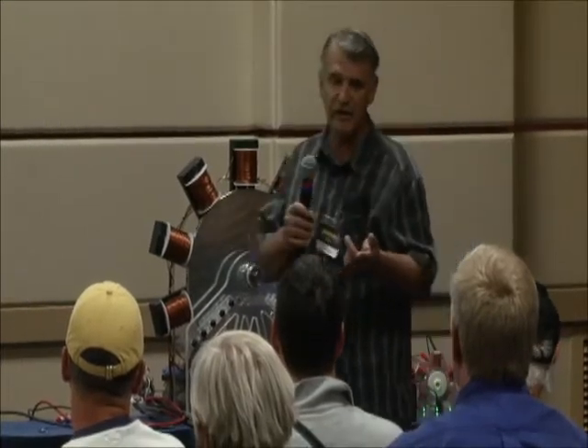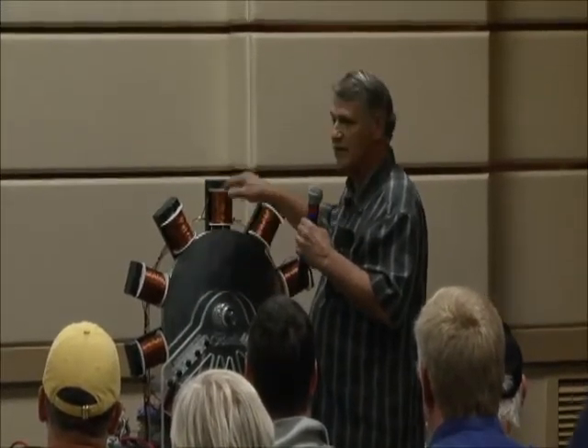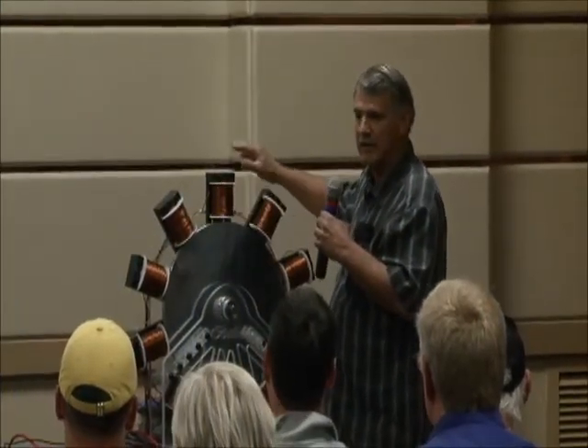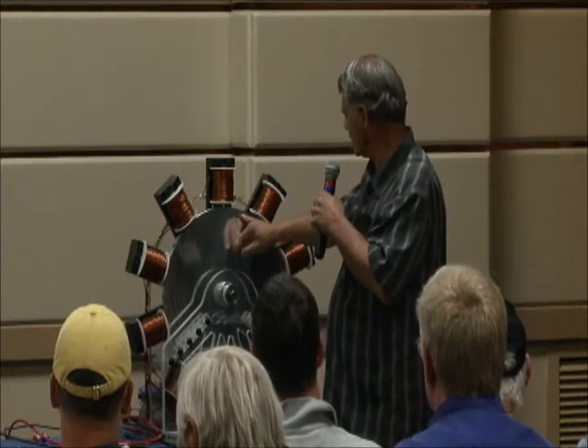The SG is a self-rotating magneto, which means that when the wheel turns, there's a magnetic pulse that goes into the coil, and when the magnet leaves the coil it generates a pulse that turns on the transistor.